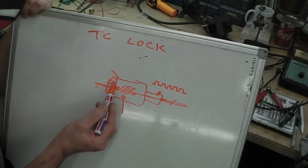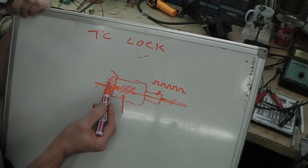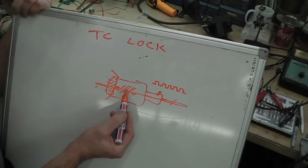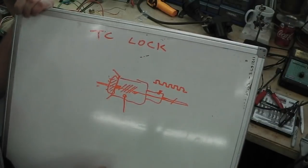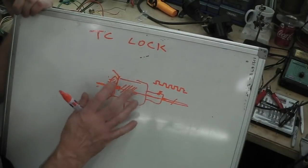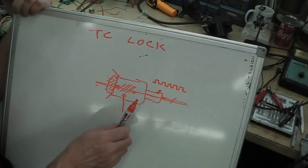As soon as you let go, it starts to gain speed and starts to spin the torque converter up. So it creates a viscous coupling between the engine and the gearbox, so you don't stall your car. That's just touching the outer knowledge of torque converters and auto boxes. We don't really need to discuss that because you're probably more knowledgeable than me about that torque converter. But that's how it was always done.